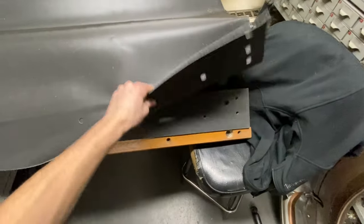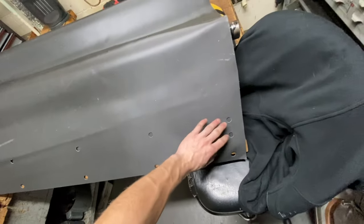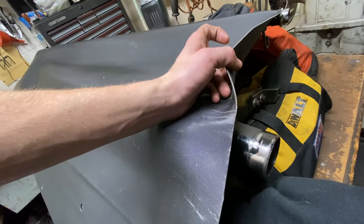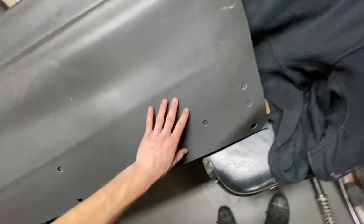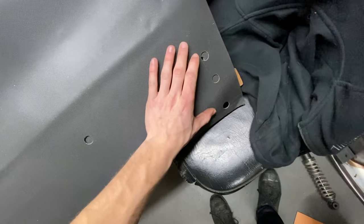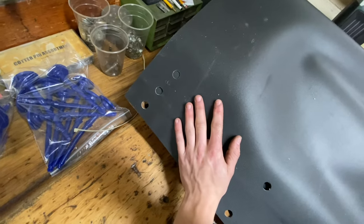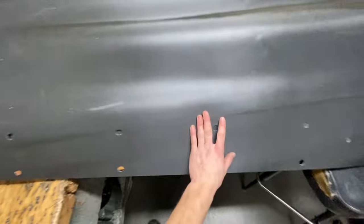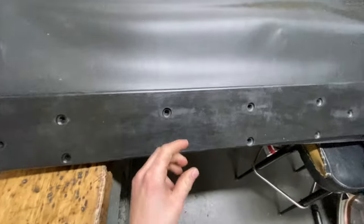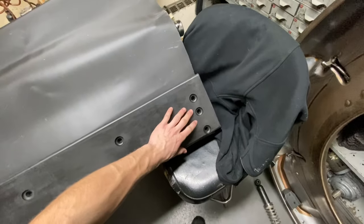I've also added the curtain on top of the sponge. Make sure you put it on the right way — on the side with the attachment for your shock absorber, you're going to have a larger pattern in the rivet holes, and on the opposite side they'll be closer together. They'll all line up, which is your double-check. After properly aligning the curtain, add your rubber piece on top, making sure it's facing the right way.